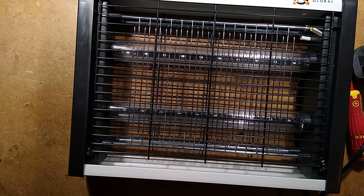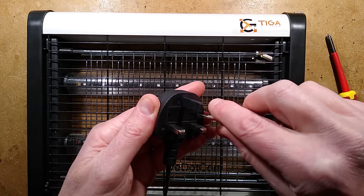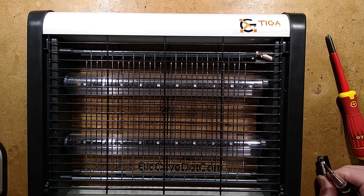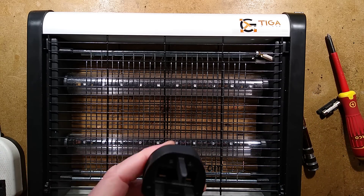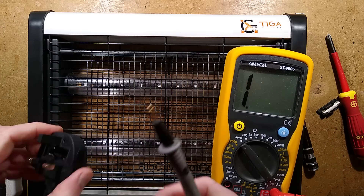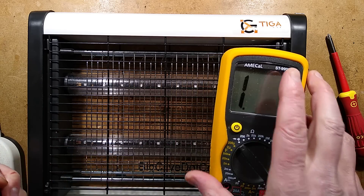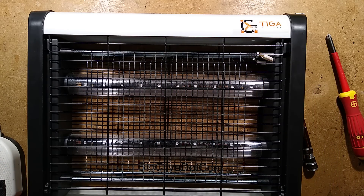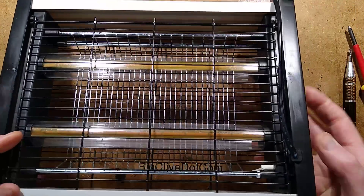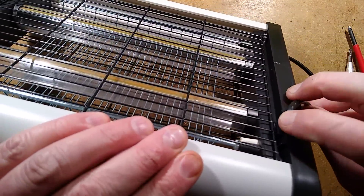I'll put the HAPI out of the way at the moment. The first test, as always: it's got a square pin plug in it. Let's pop the fuse out and see if it still operates with the fuse out, and also check what type of fuse it's got. It says it's a 3 amp fuse, which is good. Plug it in — does it light? It doesn't light. Let's double check that it's on the correct connection. Continuity — it's on the correct pin. Note that it's got a plastic earth pin — that's fine, this thing is not grounded. I'm guessing that might be because the grid in here will be powered pretty much directly from the mains via a voltage multiplier, and there's going to be a semi-capacitive dropper for the LEDs on the back. It kind of loses points already for the fact that the insulation is broken on the wire — it's kind of fragile there. So where it goes in, it's exposing the blue conductor.